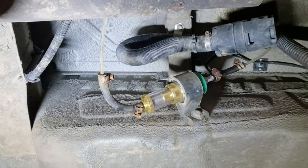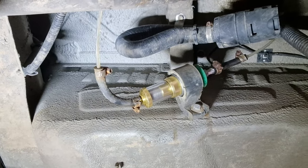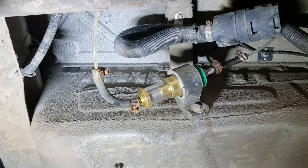I'm going to check if I've got any fuel line. All right, we've swapped out the old pump and the new one is in there. I'm going to order a new bracket and some better quality clips, and while I'm there I'll get some new pipe — all that equipment has been in there a couple of years now and it's corroded more than I expected. So new pipe, new jubilee clips, a new bit of fuel line, and a new bracket because that hasn't weathered well at all.